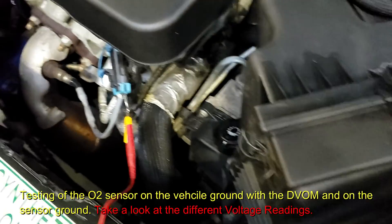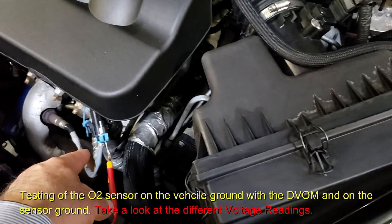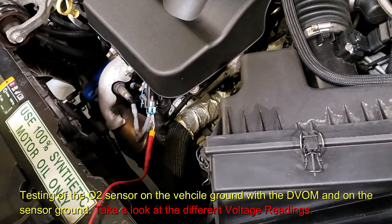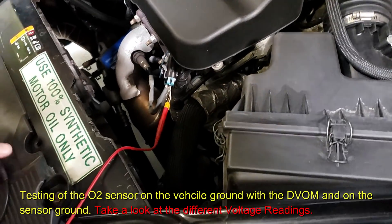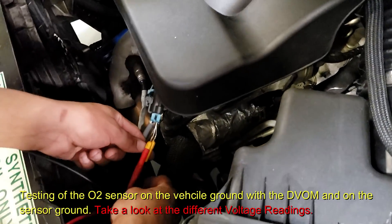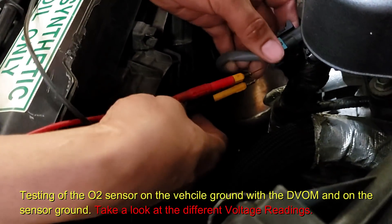This may be sensor ground — that's chassis ground. Let's take the black lead and go to the other wire with the pin. Now the other wire — not the two white wires. What color wire is that? Black with the red. That's the signal wire. Not the gray — the gray is going to be the ground.